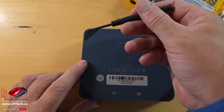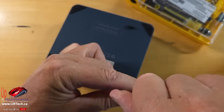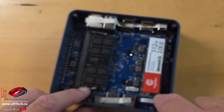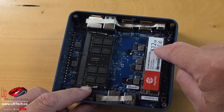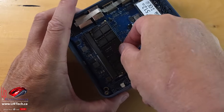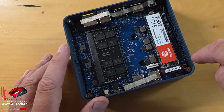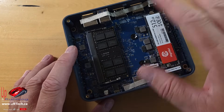Let's pull it apart. You will need a very small Phillips screwdriver. There's a little tab — just pull it up. There's your SSD, and that's a full 2280 form factor, 22mm by 80mm, which means you can put a 4TB drive in here if you wanted to replace the 512. And there's your DIMM slot — replace the memory just by prying those clips open and popping it out. That's about all there is for upgrades. The CPU and CPU fan are on the other side — to get there you'd pull out four screws, and if you ever do that, make sure you blow it out for dust.